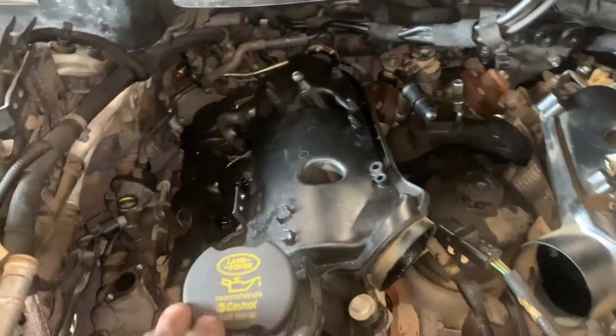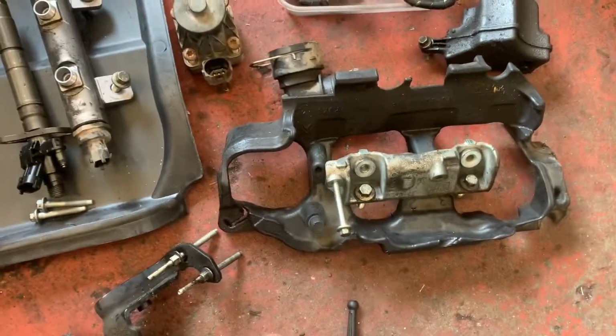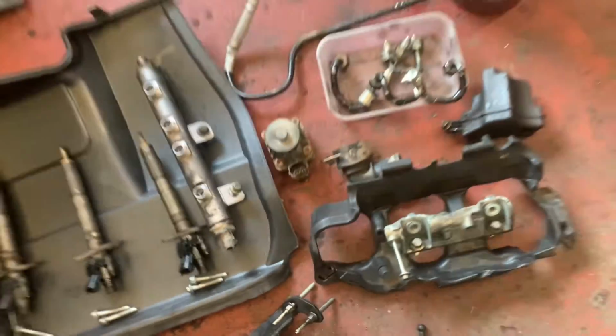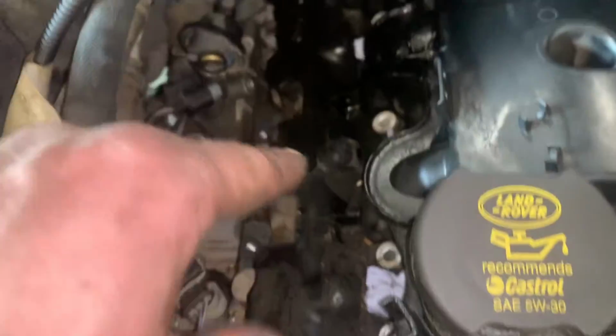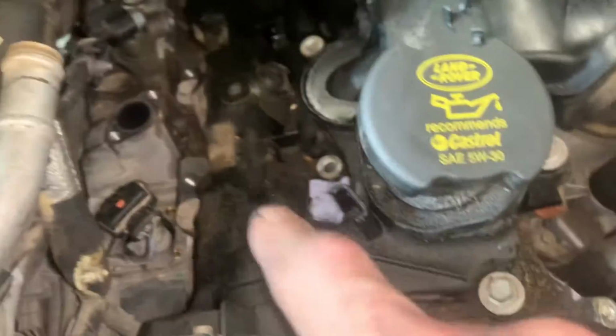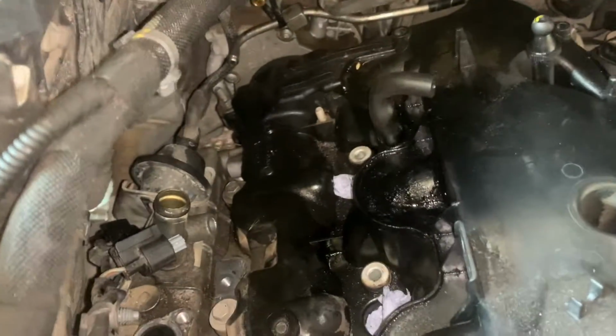I'm still not done yet. I'm stripping. Obviously, let's take off fuel injection system, fuel rails, both sides, injectors out of both sides, top of the EGR motor, etc., so it's not a small job. This side's pretty much ready to go now. We've just got the bolts that hold the rocker down and the inlet down. And undo. And this one will lift off.